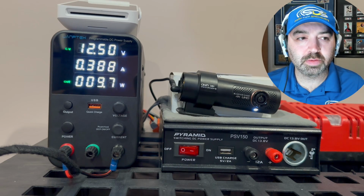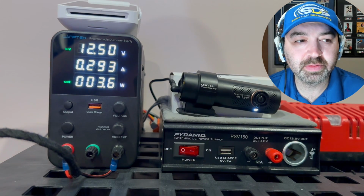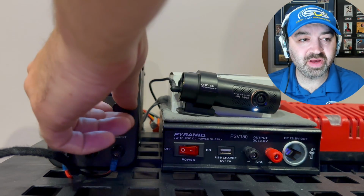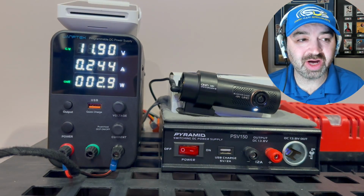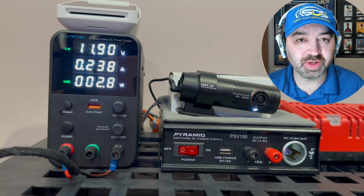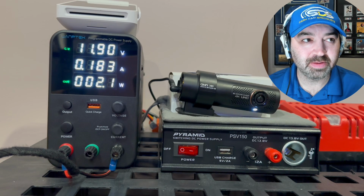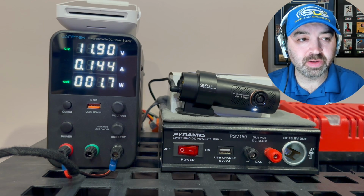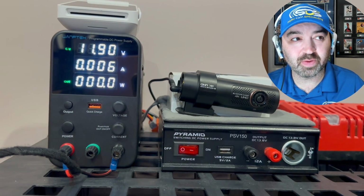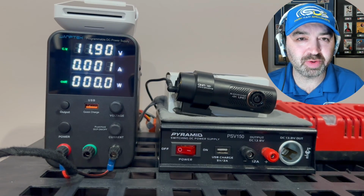So we're going to put the Blackvue into parking mode. Parking mode on. And within about 10 seconds, it shuts off very quickly from the low battery protection. However, what happens next is weird. Powering down. It takes another 2 minutes after this before it's drawing any more current from your vehicle. And I think this is just a supercapacitor.